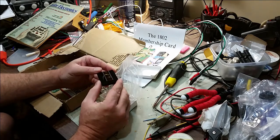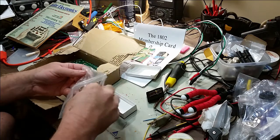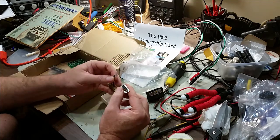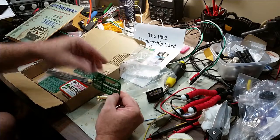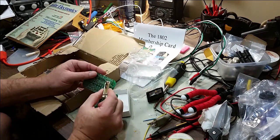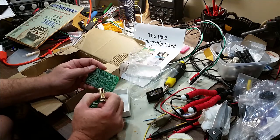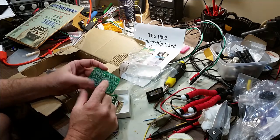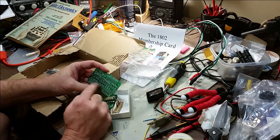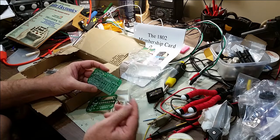This also comes with everything you need — which isn't much — to make the serial interface work. It plugs in on the front panel. There's an opening and a 25-pin socket that lets you plug in an RS-232 terminal. You can also use the same port to connect to a parallel port on a computer, which will let you download programs instead of needing some kind of bootstrap that you have to manually enter. One of the cool things about the 1802 is that it lets you enter stuff directly into memory without having to have any program running. There's a way to basically emulate any of the switches with input signals on the parallel port, using the right software.